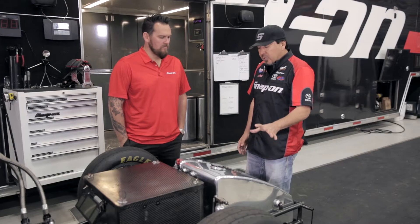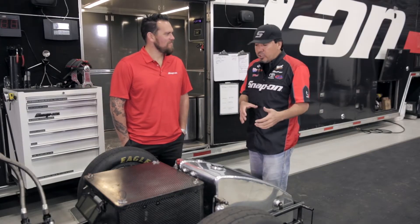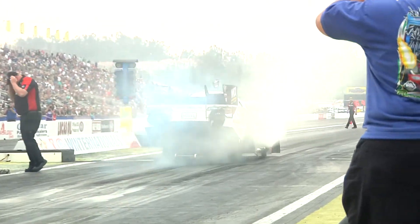It's in front of the center line of the tires. So if it's right, you'll see the front end come up just a little bit. Imagine if you burn too much fuel — that front end's going to be light, and the car's going to want to wheel stand.